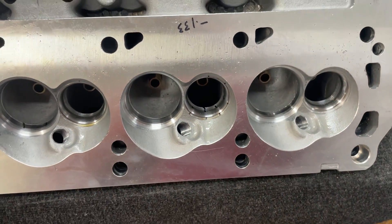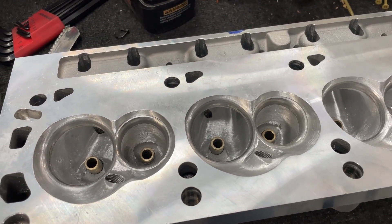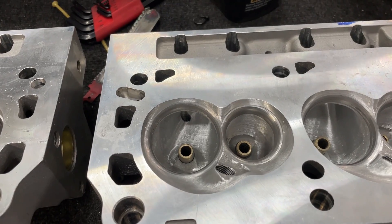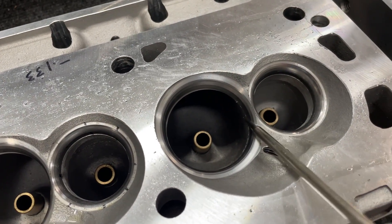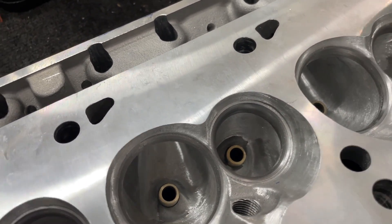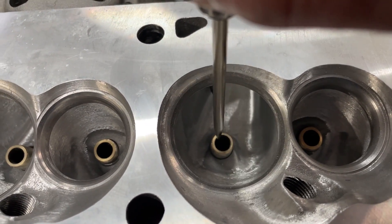Okay, ignore the mess, but I'm going to show you what's been done — I'm going to go over just about everything on this. I actually finished porting this head. I know I probably should have recorded the whole process but I was really trying to get stuff done. On the intake throats: they were here originally, and I ended up opening them up to 91.5%, which is actually pretty big. The only reason for that is I was trying to get as much of that ridge out — the ridge was worst on one cylinder and got better going across. They all went to 91.5%. On the bowl itself — measured straight across the guide — it's 98%.